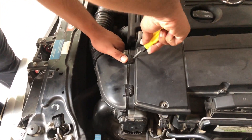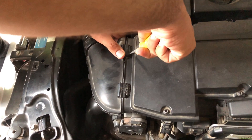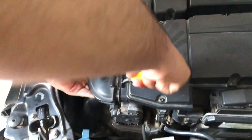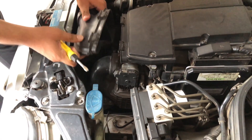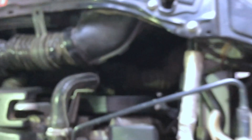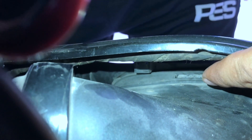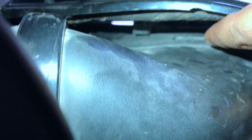Just to make things easier, use a flat head screwdriver to push these two locks and pull the hose outside towards yourself. It should come out with ease — it's a very easy step. Also push this lock behind the main air inlet. It is hard to capture on camera, but I am pretty sure you will find this easily when looking with your eyes.